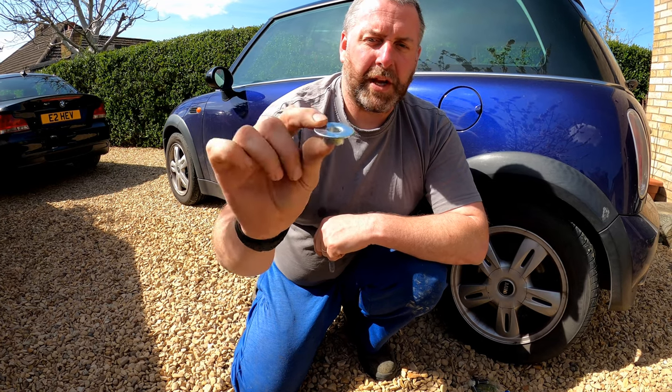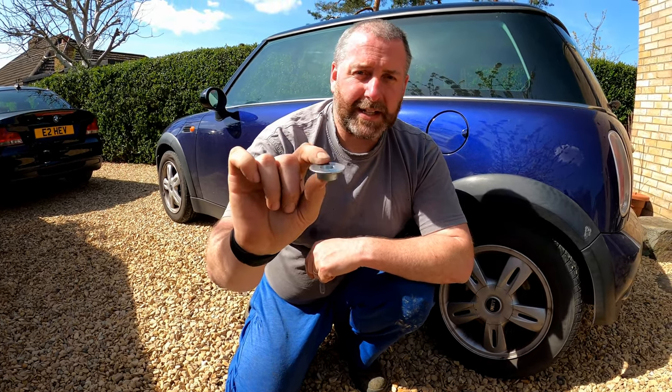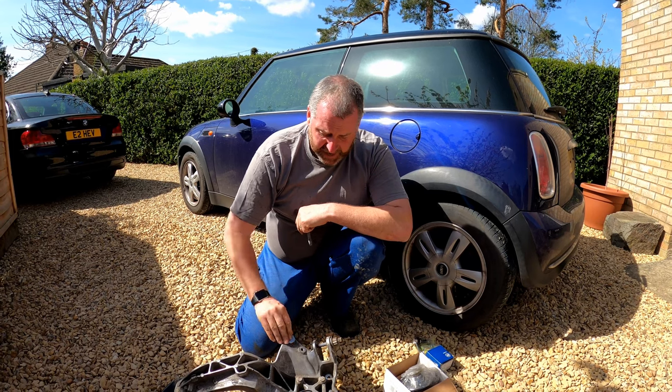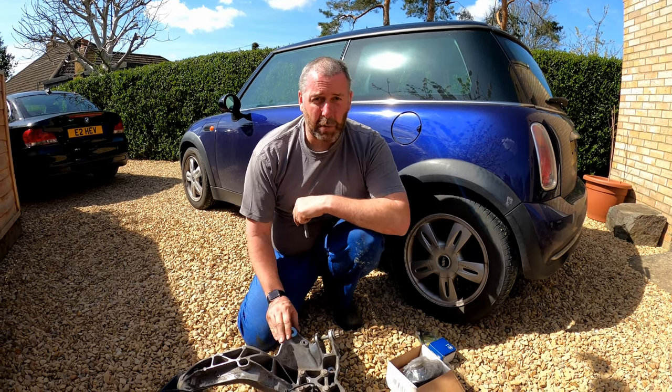Now, these are pretty cheap. They're on eBay. I think they were 30 quid for a pair from Modern Mini. I'll leave the links to that in the description so you can go get them, or if you've got a lathe, you can spin them up yourself quite easily. And they simply fit in there and allow Gen 1 shock absorbers to be used on a Gen 2 arm.